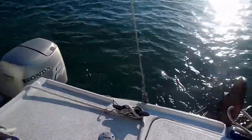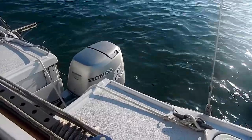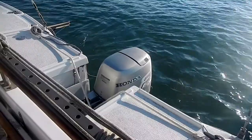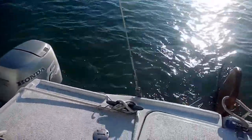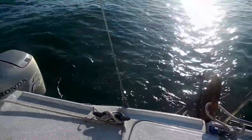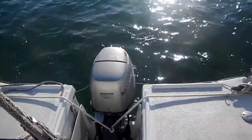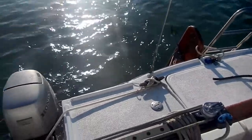But this motor is steered by little strings that are pulled by the rudder cassettes. Without both rudder cassettes articulating, the motor is not going to turn. At best, it'll turn the boat to port — when this rudder pulls to port, the motor will turn to port, but there'll be nothing pulling it back to center line or to starboard. That's not going to work. I'm not going to get a cable overnight, so I'm going to try to set up so that I can steer both rudders and possibly also the motor using one steering cable and a little bit of magic.